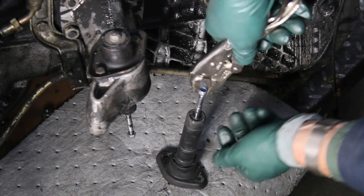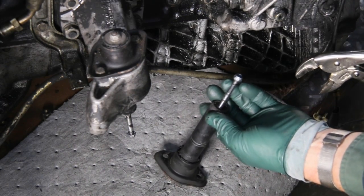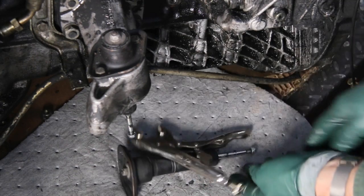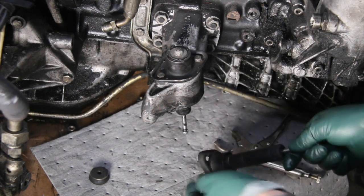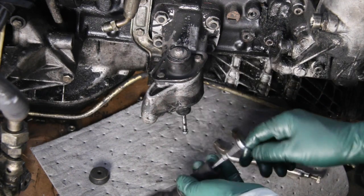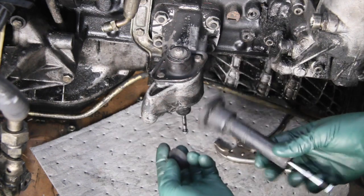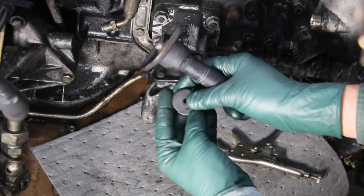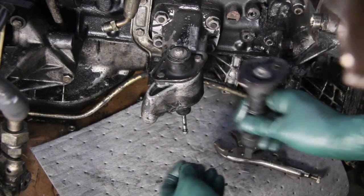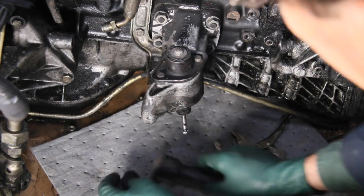So that's how you test them. You have to disconnect it - otherwise there's really no way. It's probably better to just take it out, because it's kind of hard to get down in here and get a hold of that to move the piston up and down. The other thing you want to watch is the rubbers on this end here wear out too, so you need to inspect those - make sure there's no play on that lower end where it mounts to the little bracket on the subframe.